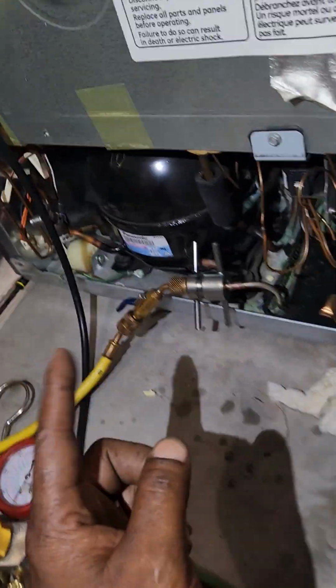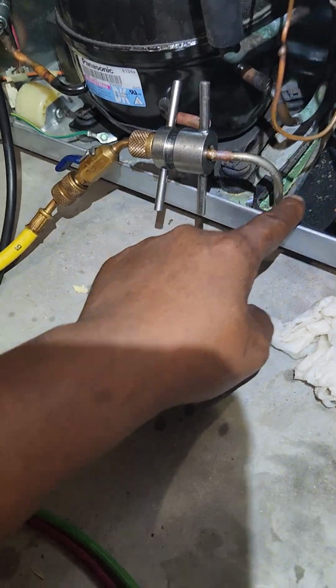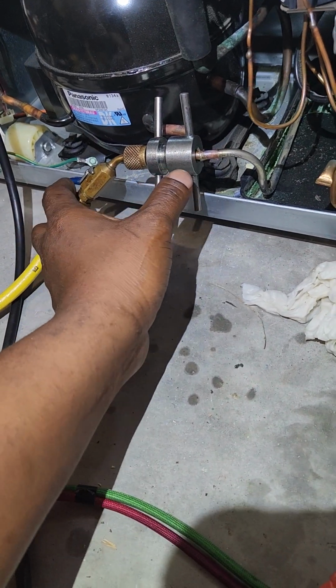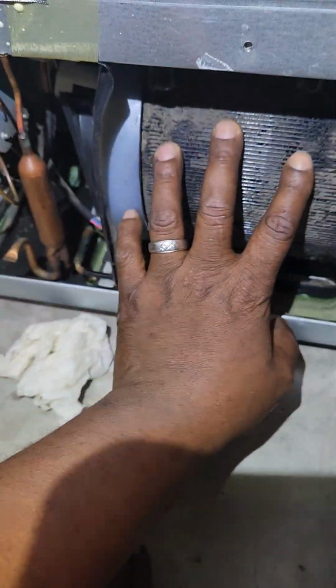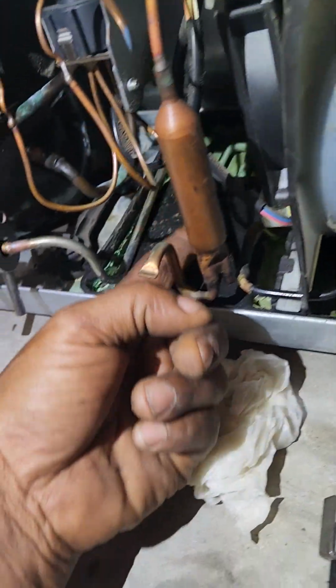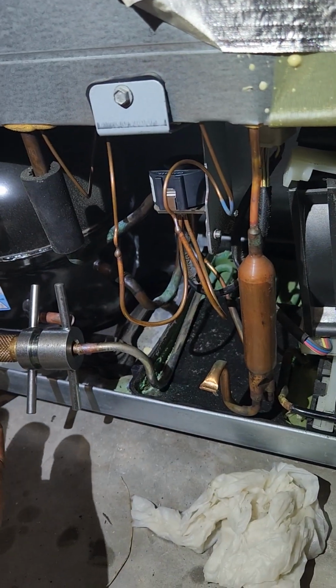So what I did was I disconnected the discharge tube from the compressor. So that's the discharge tube there. It goes to the condenser. Follow me? So I disconnected it and I run air directly through the discharge tube. That's supposed to go into the condenser, go through the coil cluster and come back over here. And it's supposed to go into the three-way valve and then out to both evaps if this thing is in